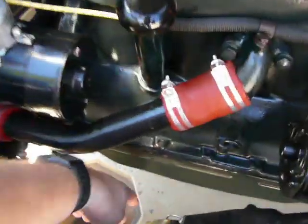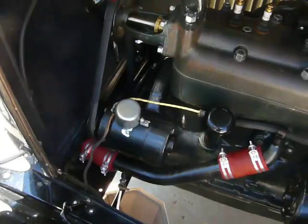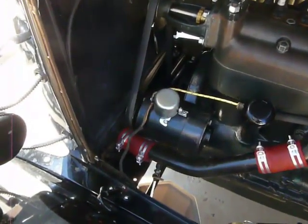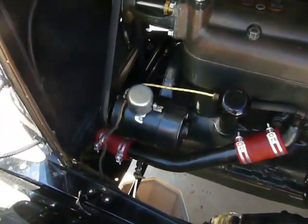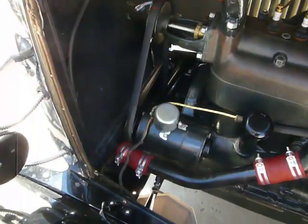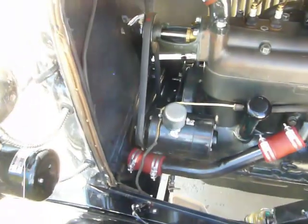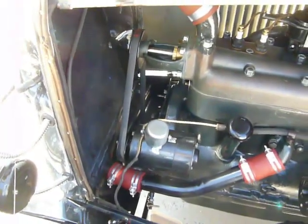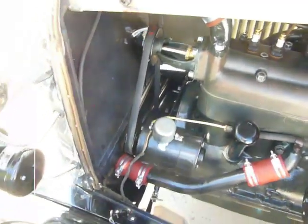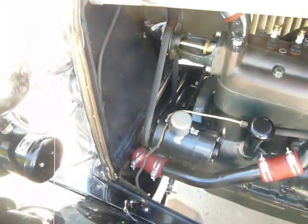Well, they say that you can leave the vinegar in for a day or a couple of days, but I never wanted to get that aggressive, so I just ran the engine around for about a half hour or so, just a chance to circulate that light mild acid through the system and clean out all of that rust. So we'll see what comes out here, and then we'll run some flushes of water through it next.